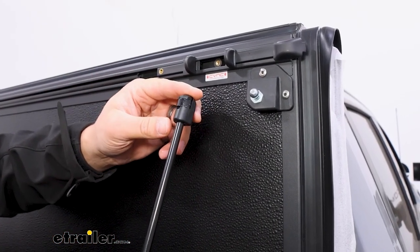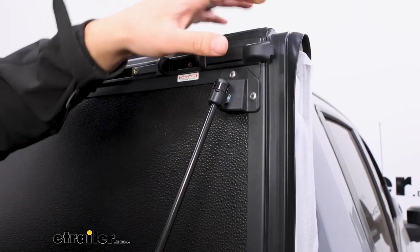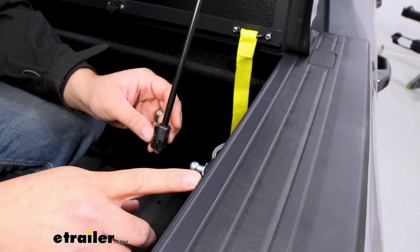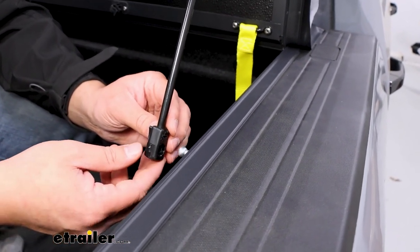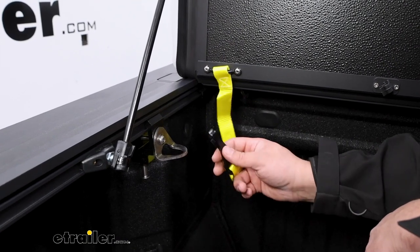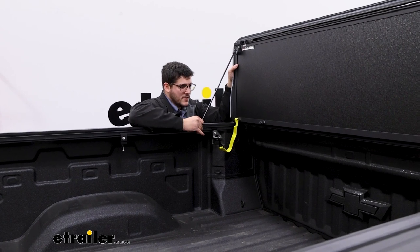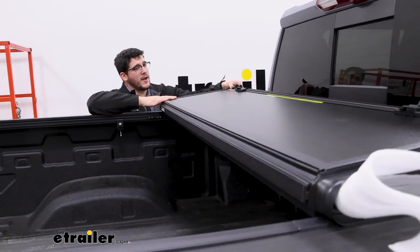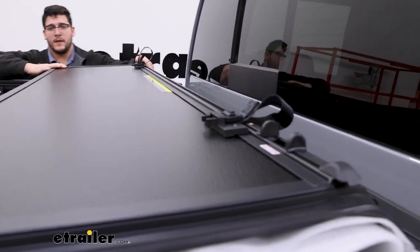Now we can actually start installing the prop rod. The one on the top doesn't have a quick release lever — so I know that one is going to connect to the tonneau cover. Just apply pressure to the back of it until it clicks into place. Then move over to our side rails. This one does have a quick release lever, and that's because when you're not using it you're going to want it to detach from your rails. That's going to be the same process — just push it on until it clicks into place. With our tonneau cover already open, take these safety straps and hook them into these safety loops. The final step is just checking how everything fits — unlatching this, storing it on the side, and making sure that our tonneau cover folds out correctly. Make sure everything looks even, it's sitting flush, and nothing's getting stopped or hung up on anything.